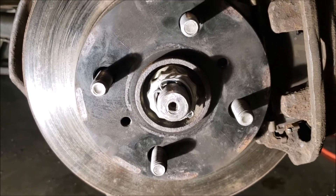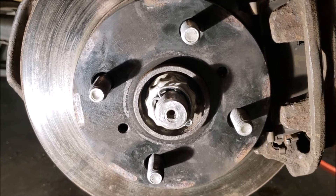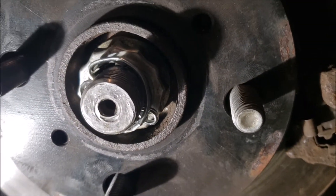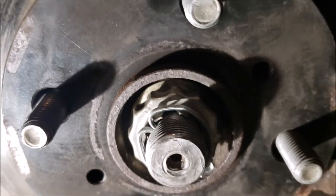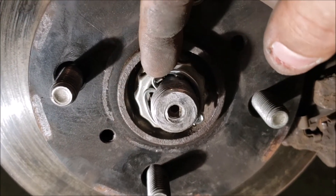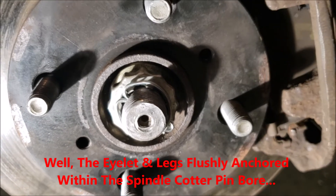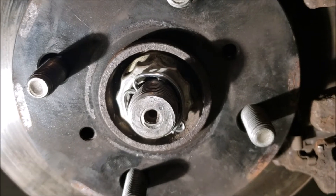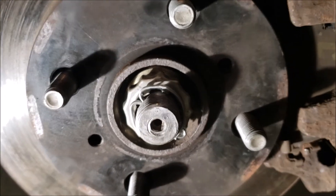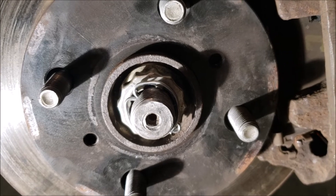I'm on the other side here. I decided to give you a treat — I didn't trim this one down. Let me show you how a badly installed cotter pin comes out so the next guy has that rusty disaster. See that? Now you've got all those different articulation bends in the legs — don't do it that way. There is absolutely no strength in anything that protrudes out. The strength is having both legs in the crossbar so that it doesn't spin and the nut can't back off. That's it. Read my comments on my cotter pin video — people just go into a state of denial when faced with a reality that doesn't align with what they'd like.